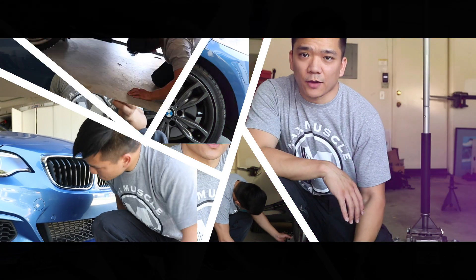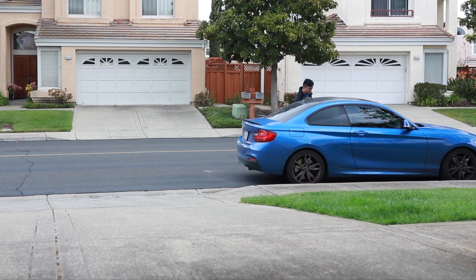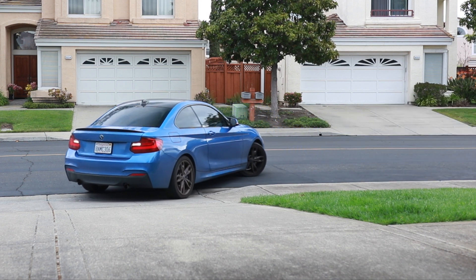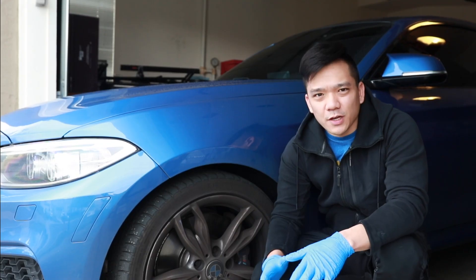Hey everyone, Fritz here. Is it weird that it rains when it's sunny? Well, we're going to take advantage of the rain stopping for a quick second to rotate those tires. If you're wondering how often you should rotate your tires, I would say every six to eight thousand miles depending on road conditions and how you drive. You should check tire pressure about half that time.